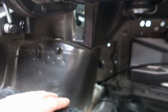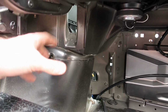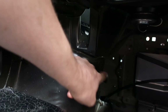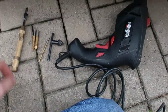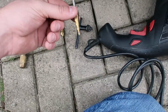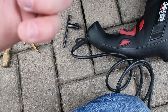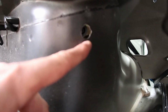and just go straight out from there. So now I've got the right fitting on there, what we'll do is fit the strut in place, mark it up, and probably drill it from the inside out for the smallest hole, and then make those holes big enough to fit the proper line through it. So with a few simple tools, we've got a center punch to mark the hole, a first drill bit to make the hole, an expander, like a Christmas tree bit, and a reamer to be able to smarten it up on both sides.